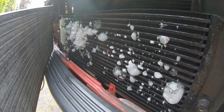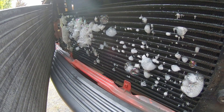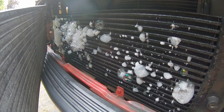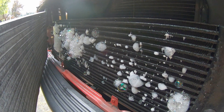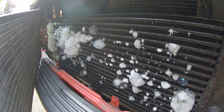This is a stock truck — the truck's about 30 years old. Don't be surprised if your stock intercooler is leaking. So if you start to do boost upgrades like a turbo, think twice. Maybe you should upgrade your intercooler first and that will get you some gains.